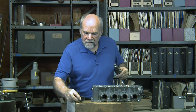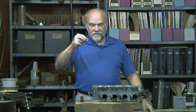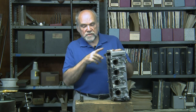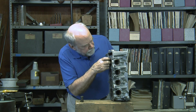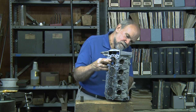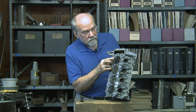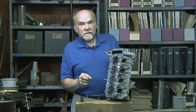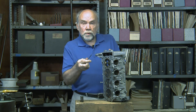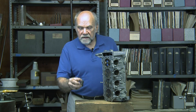There is one of these tappets under each cam lobe. As the camshaft revolves, it pushes the tappet and the valve springs and the valve open. To visualize — put in a valve. There's the valve; that's closed. When the camshaft pushes the tappet, the valve opens to admit a fresh charge of fuel and air to the cylinder.